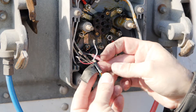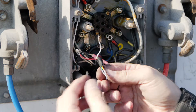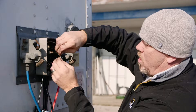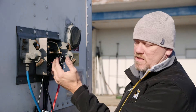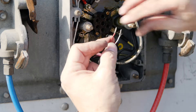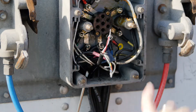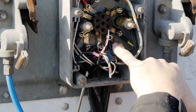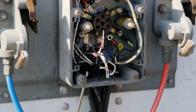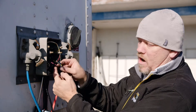That's just to separate the wires as far as the harness. When I'm finished, I'll individually tape these off and then wire nut them together so they don't interfere with anything inside the box. On a basic connection to get constant power to our asset tracker when it's connected to the tractor, we're going to take red and white and tie those together. On this individual installation, I'm going to hook it to the ring terminal of the center pin, which is constant power on the ABS. I'm going to hook the black to ground, which is on the white terminal here. Another alternative is to splice into the wire and run it through on a poke-and-wrap method to secure it to the wire.